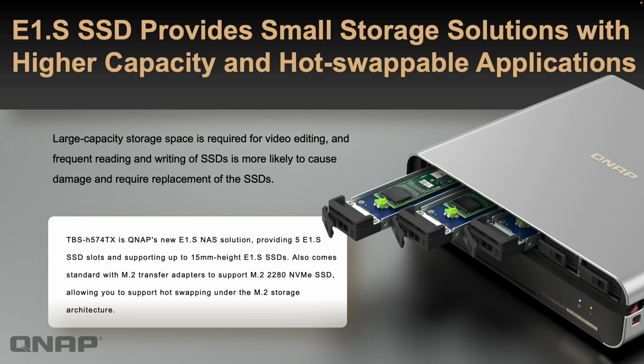Here's a look at the small drive trays. They have an E1S adapter that lets you place an M.2 drive on and clip it down into a secure green clip. This effectively makes M.2 hot-swappable — the M.2 connection itself isn't being hot-swapped; it's the E1S connection being hot-swapped when you pull the tray out. Once it's out, change the drive on the tray, push it back in, and you've effectively hot-swapped an M.2. The trays push straight in and a vent grill covers them.